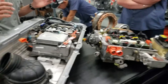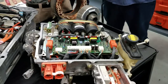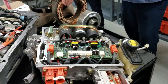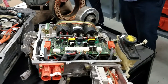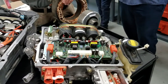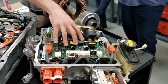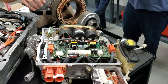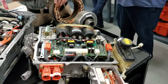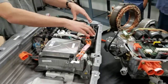Number twelve is the case of one of these — this one right here is the actual inverter assembly. We call it an inverter, but it has both: it's an inverter and a converter. On the Toyota Gen 2, there are actually two inverters and two converters: the DC-DC converter, the boost converter, the main IGBT inverter, and the inverter down to the AC motor. But we just call the whole thing the inverter assembly.